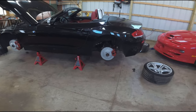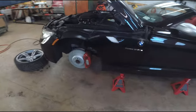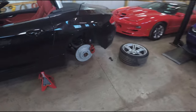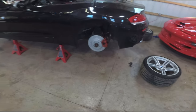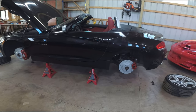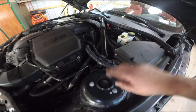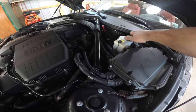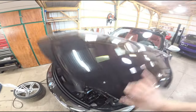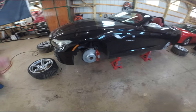Here's the car — it's all done. Got the calipers on, got the rotors on all four corners. Everything's nice and tight and clean. I hit a little bit more red spray paint where I got things dirty. Before we get to putting tires on, make sure to put the cap back on your brake fluid reservoir. Once that's on nice and tight, close your hood and put all your wheels and tires back on. Torque them down to 100 foot pounds — don't go over a hundred foot pounds and make the next time you try to get that wheel off a nightmare.